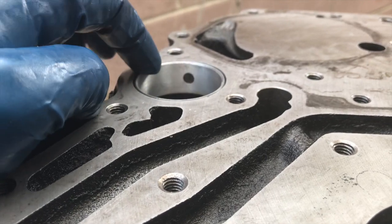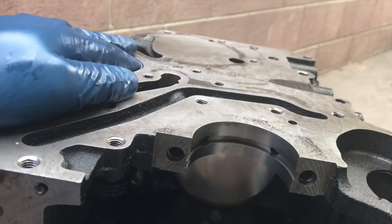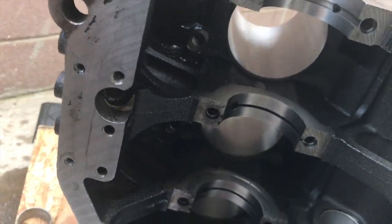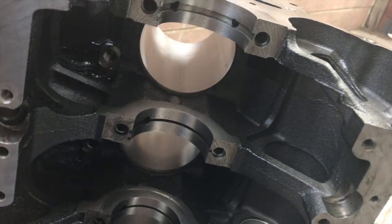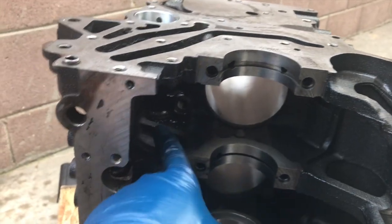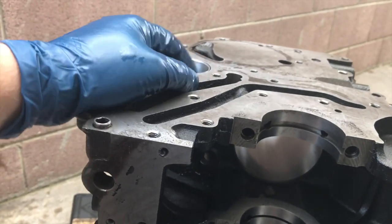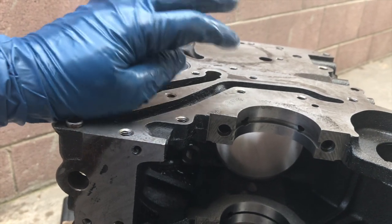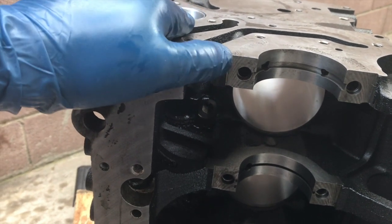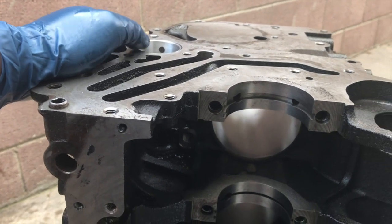It's very straight and a little bit lower than the block deck — that's what I was going for. Now the next thing is to clean the whole block and put a little WD-40 all over so it doesn't rust again. I'll clean it with the scuff pad and start assembling the block, because once you put the crank in you'll barely have enough space to reach these areas. It's better to do the elimination kit first while the block is empty, and then start the assembly. I hope this video was informative — if you have a better way or other tools to use, please put it in the comment section. See you guys in the next video.